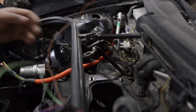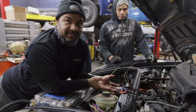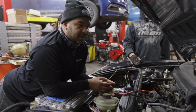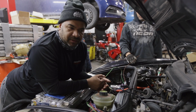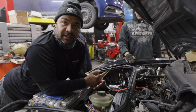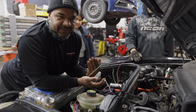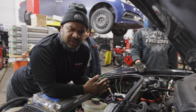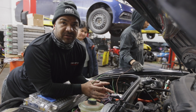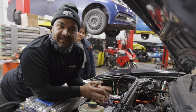And then we were thinking, just in case something happened and Kevin can't stop the car, we don't know, right? I know a lot of guys have stop switches where they can hit the power and kill maybe the computer or kill the power from the 400. We have something called an inertia switch. If he has an accident, a certain amount of G's will knock off the sensor and it will probably kill the power to the motor or the capacitors. Oh, smart, something like that as a safety thing.